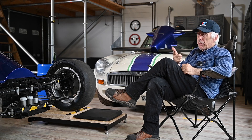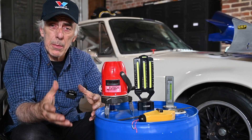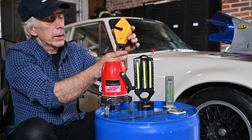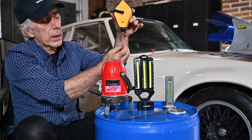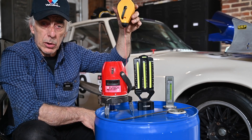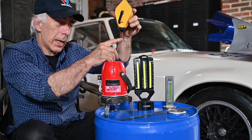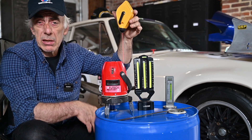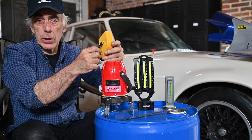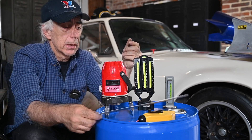We'll also look at what tools you need to adjust camber, and then finally we're going to adjust it on this race car. The cheapest tool on the market is nothing more than a bob weight. You attach a bob weight, let the string go down through the center of the wheel top to bottom, then measure the distance between the top of the rim and the string, and do the same on the bottom. If the distance is equal you have zero degrees.